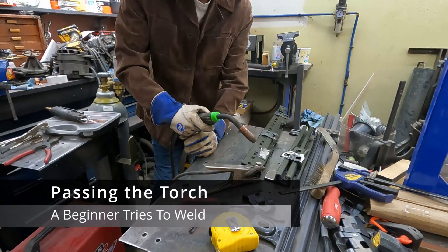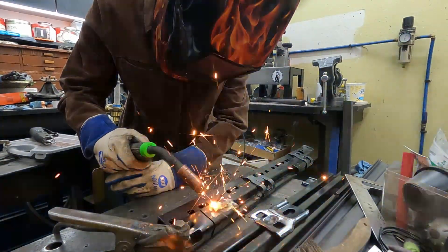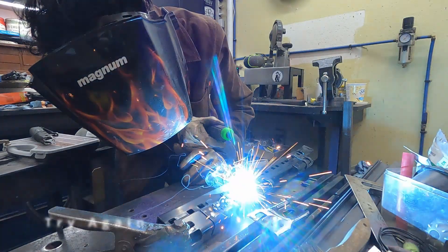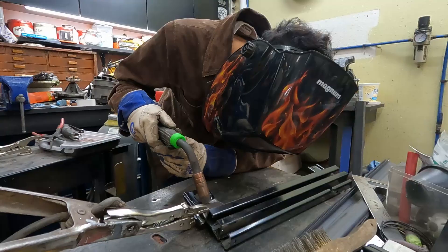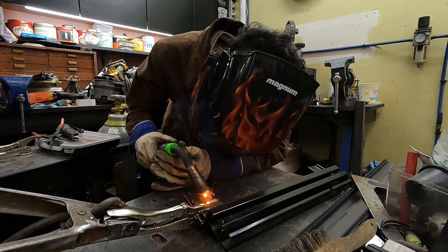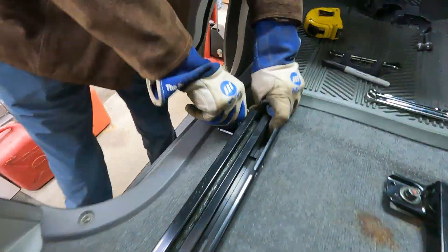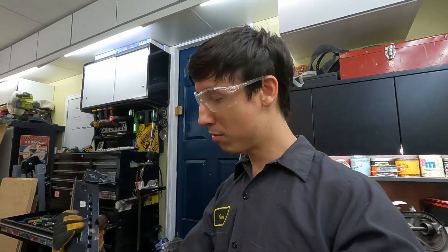Bring the gun up higher even while welding. You'll know if you start pulling away or working too close — it's going to start sounding funny. Too airy and it's not going to hold anything. First time! All right, we've got to come out now because we've got to weld the rest of it. I'll let him do the tack but I think for the final weld I'll do that, and might make him weld the bottom up — we'll see.